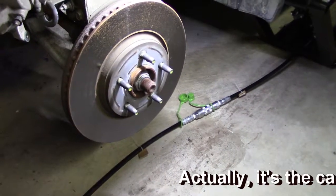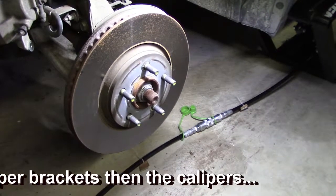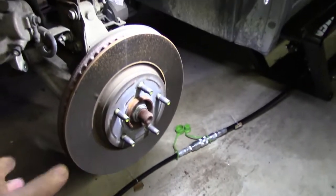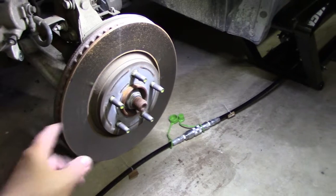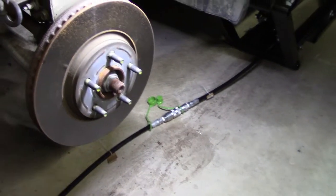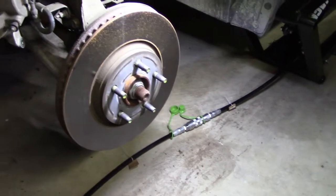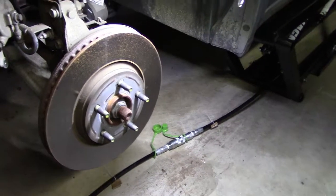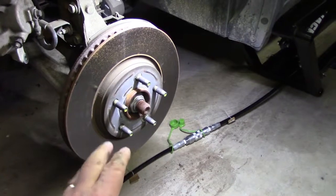So again, I've got the new rotors. I'll go ahead and put the new rotor on that passenger side and get it ready. These rotors now have a coated style, and you don't really need to do this, but I've got the standard style. They usually have some kind of a chemical composition on there. I think it used to be called cosmoline, if that's what they still use. Anti-rust compound, so when it sits on the shelf it doesn't rust. I'll brake clean both sides since they're new, and then put those on, then put the bracket and the caliper on. Now let's work on these calipers.